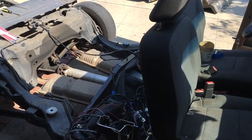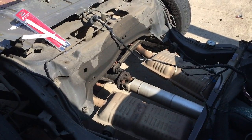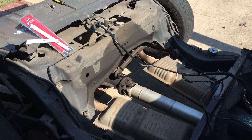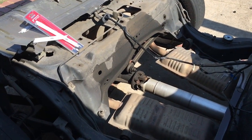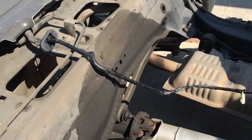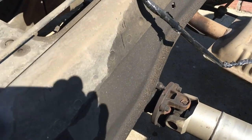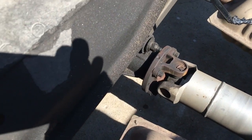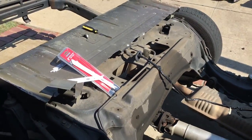We shall now spin her around. Look at that. As far as axle code goes, it says that this is a 327 with a posi in it. Look at the leak. It's been spraying on the frame. God damn it. The front seal as well. You've got to reset all the clearances and stuff. Okay, so anyway, that's that.